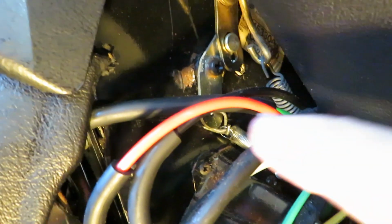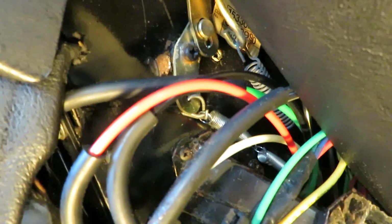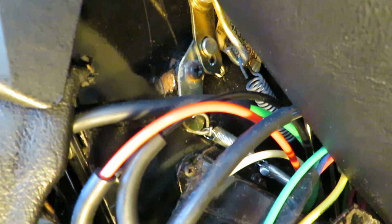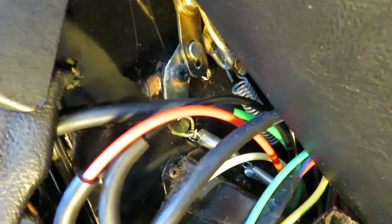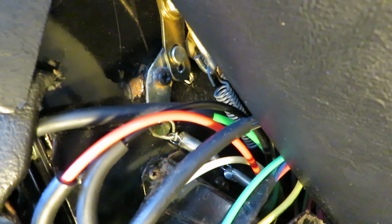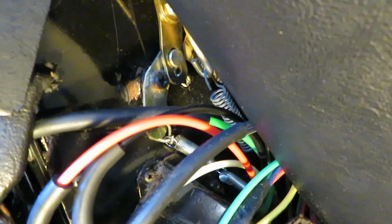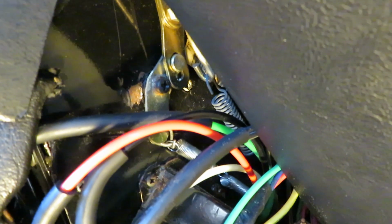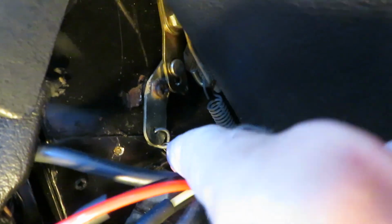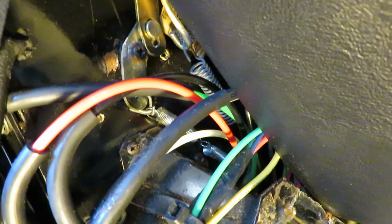Now, up in here is the servo. The servo is a device that has little cams and switches, and that's what changes the settings on the air conditioner. It's a little motor and it rotates, and that opens and closes pneumatic valves and little electrical switches. When it's running correctly, you can see this lever here move, and you'll hear it whirring when it's working correctly.